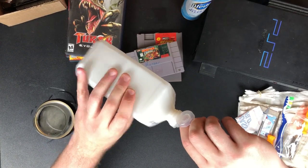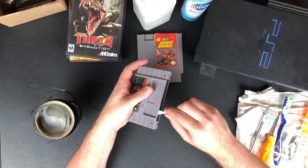Piggyback off that topic — you've got to learn the craft and learn how to clean and repair. You need a cleaning kit and a repair kit. Can you fix an NES? That's probably where I would start. Fixing an NES is actually very simple — it's a simple machine to open up and put a new pin set in. And a lot of people think their NES controllers are fried and give them away for free or a dollar. All you have to do 90% of the time is re-pad them. You can get pad sets on the internet for super cheap. Anyone can do it, and boom — you have a brand new feeling NES controller for dirt cheap or free.